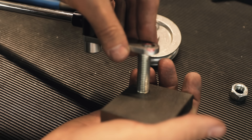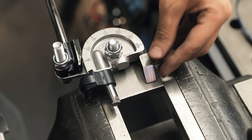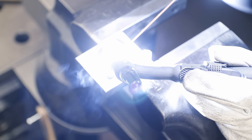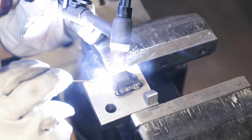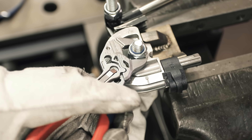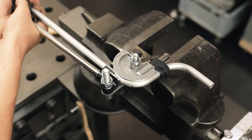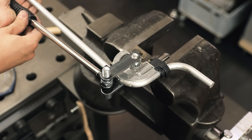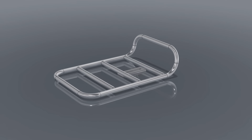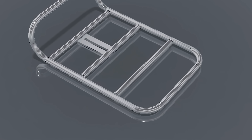Now let's get back to the video. I'm grinding that surface flat so it looks like I totally cut that off on purpose — much better. I'm now going to mount the whole thing to a steel plate I just drilled a hole into, bolt this onto the plate to create a stop for the die, and then there'll be another smaller one on this side to prevent it from rotating the other way. And it looks like the bender is actually working great now. Adding the support bracket on top actually makes it work worse, so maybe it needs a little bit of slop — but the bottom line is the tool works.